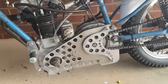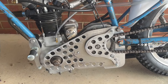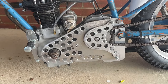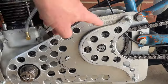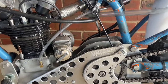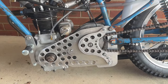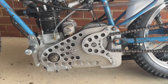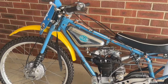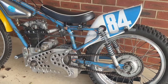Now with the primary cover — I know it looks a bit of overkill — but the big main part of the primary cover is a structural member as well. Because the engine plates are so close together, it's just to help make up the strength. We've gone from this bolt to this bolt and back down to the bottom there, and that's going to help support everything. We've just got to give those a bit of clean up today. Three spacers need to be machined up and then bolt that on. Then we'll tidy the cables down, refill it with oil, and get ready for a start.